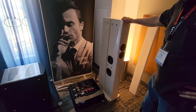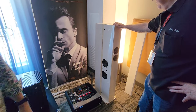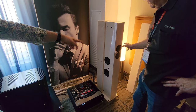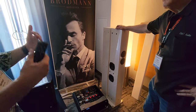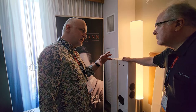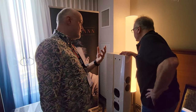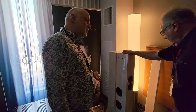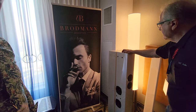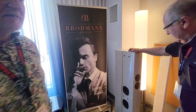That means you have to sit outside the hall radius, and the hall radius is around here. So this speaker is not good as a headphone. In this model: four bass drivers and two tweeters — six total. Together with that port that acts as a horn resonator, electrically we have a two-way system. Acoustically, we have a three-way system. This port is a linear port and therefore a low-pass filter, so acoustically we add that third frequency range from the inside. Measured, this one goes to 27 Hz at minus 3 dB.